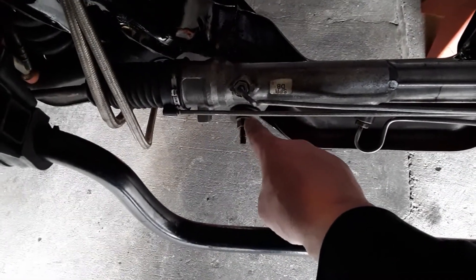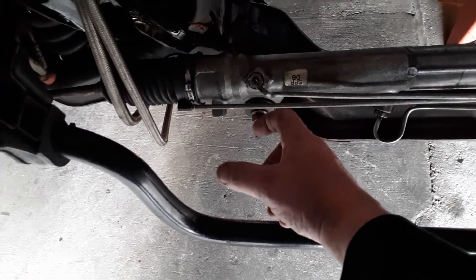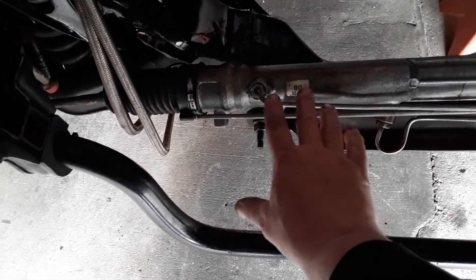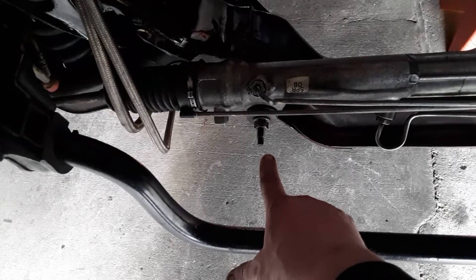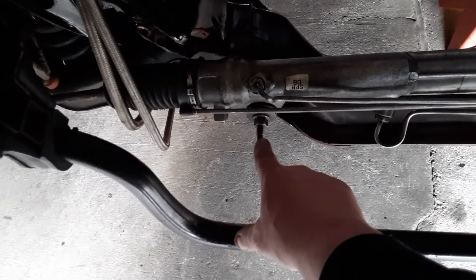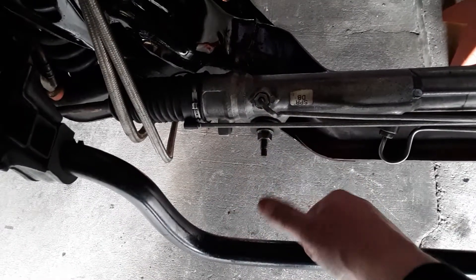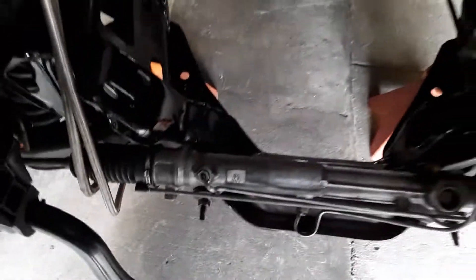Word of advice: the bushings down here — if you go with a really good new bushing from Energy Suspension, they're tough and hard, which keeps the rack planted and still from swaying under hard turning. But they're very hard to get the rack on. You have to do some massaging of the stud — taper the end so it doesn't dig into the new bushing. That's why I went back to the regular bushings that came with the new rack.